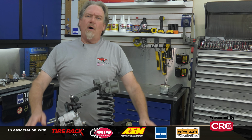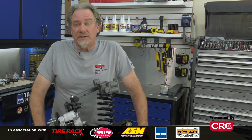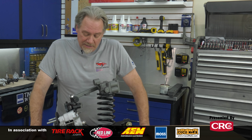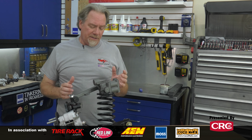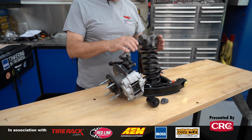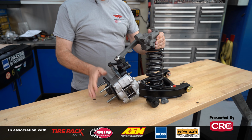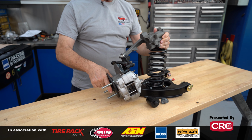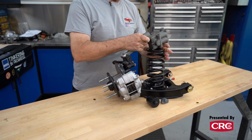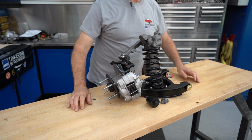So while all British cars, and for that matter, Alfas and Miatas and others, have roughly the same type of front suspension, the Sprite is a little different in that while it has a lower A-arm, it has no upper A-arm. This lever arm shock actually mounts to the body, and that acts as your upper arm. So that makes this a little unique and, quite frankly, kind of goofy.